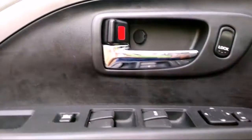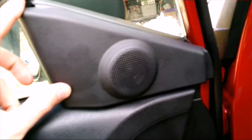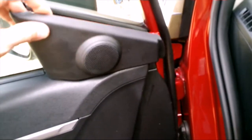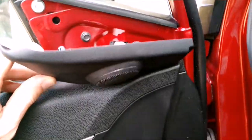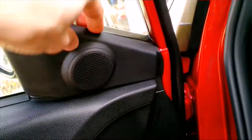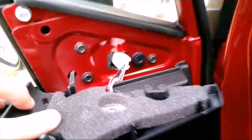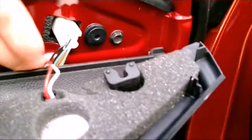We want to expose those screws and start there. Both of these little screws are removed — be careful not to lose them. I would suggest placing them in your cup holder. We need to get the cover for this tweeter off, which is fairly straightforward. Don't be too forceful. I did not use a screwdriver — I just used my fingers, pried behind the rubber seal and this plastic cover.